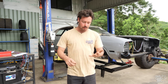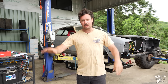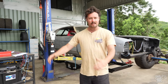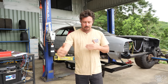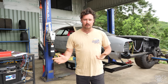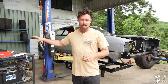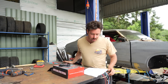There are a couple of switch panels to control all that. You've got your inputs and your outputs. Your inputs are user inputs - what you do in the cab when you're sitting at the steering wheel, what switches you have, wipers, indicators, all that. Your outputs are what they are controlling - the lights, the physical things on the car that are going to be turning on and off. In between that you've got all your wiring. Some things that pull a lot of current will need a relay; other things not so much, like LED lights can pretty much be powered straight from the switch.